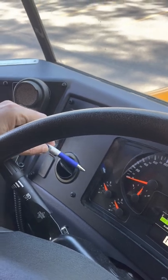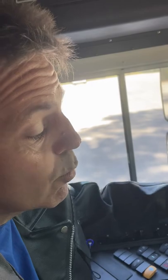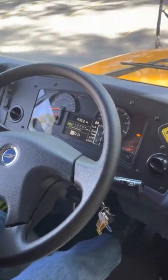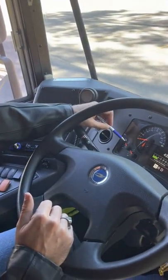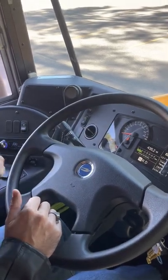Now what I will do — I will fan off the service brake with my foot, which will make the air pressure decrease. And before the air pressure reaches 55 psi, we will see lights on the dashboard, a message on the dashboard, and we will hear a buzzer. I will indicate that the pressure is at a dangerously low level.